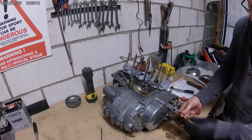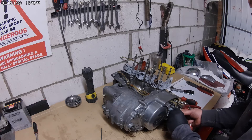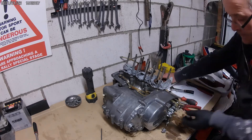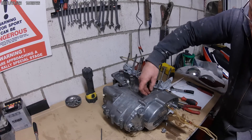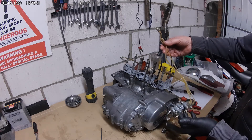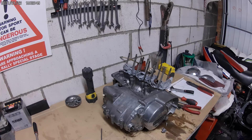That was tight though - wow. I've got one, and another - fantastic. I'm just going to take the little screws out of there and see if we can thread this out. It's quite a delicate oil injection pump. It's got a little flap there for the drive for the oil pump. This is just going to go in the parts tray, kept away from everything else, not stressing these plastic parts at all.